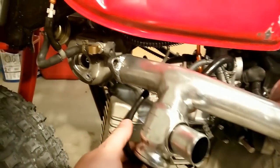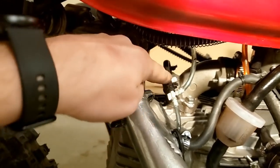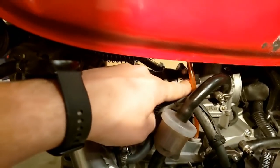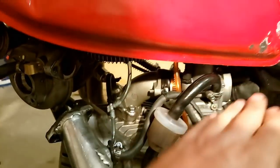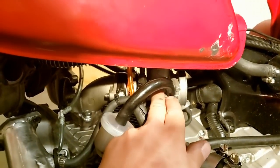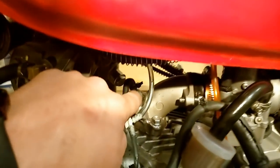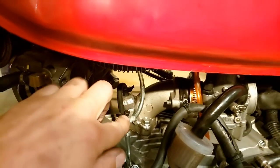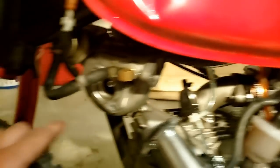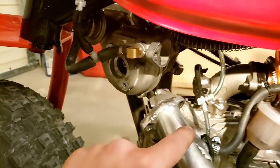This nipple on top you want to reference to boost after the carburetor or throttle bodies if it's fuel injected — somewhere between the carburetor and the motor. So when you shut that butterfly valve or slide, it shuts off and pressure can release. I have my nipple tied in right there, and that's also tapped and goes to my boost gauge so I can see what the motor is actually seeing, not what the turbo sees.